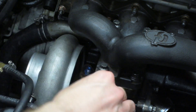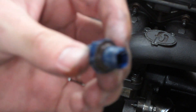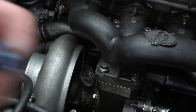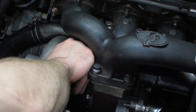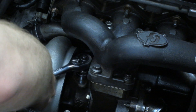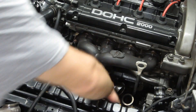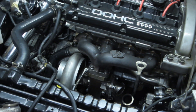The oil inlet fitting on this unit is equipped with an inverted flare and is sealed with an o-ring. The CHRA gets pretty hot and the manifold is right above it, so anytime I'm in this general area doing any work, I try to replace it for peace of mind.